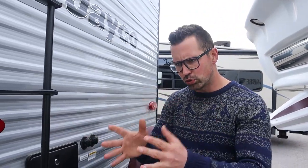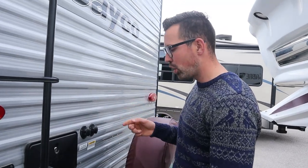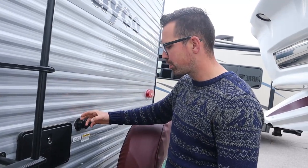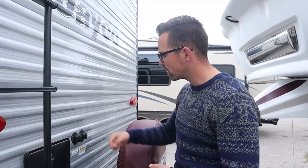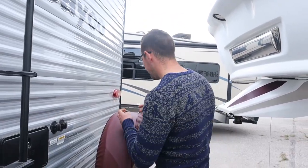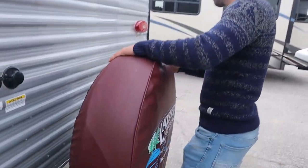The city water connection: if you have water at the site, hook up right here and turn the water on — you'll have water at your taps, shower, and toilet. It is a good idea to have a water pressure regulator to bring pressure down to 65 PSI, because some sites can have up to 120 PSI and you can blow a line or a tap. There's also a label here that says 'black tank flush valve' — that's the black water flush kit connection we talked about.